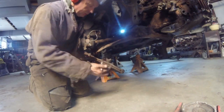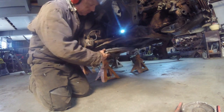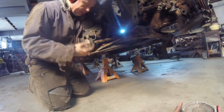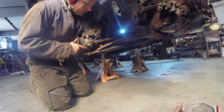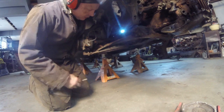We have the Passat control arm right here, and we have the Coupe GT. You put this up here, we're just going to tack it, just to hold it from going in and out. That's it. It's not going to be stabilized. But if we look at it, the CV comes in and out like this, so we want to give ourselves enough margin of error.